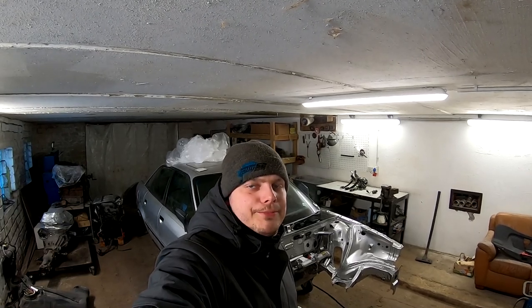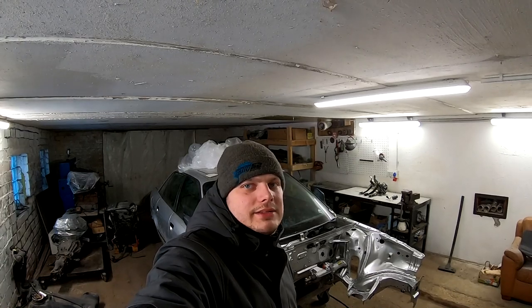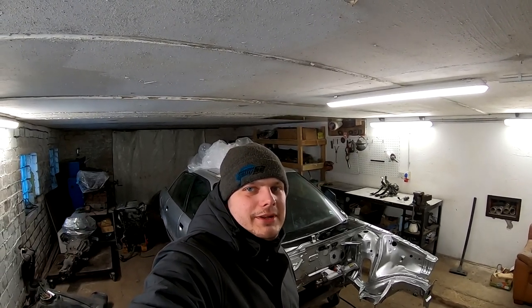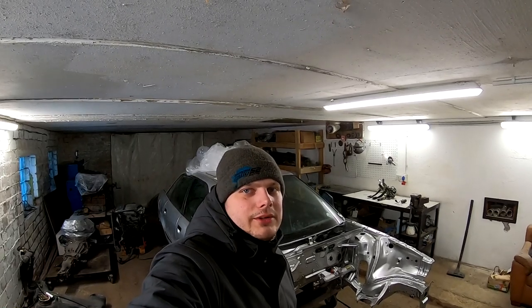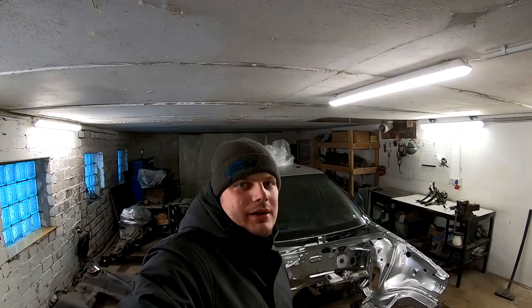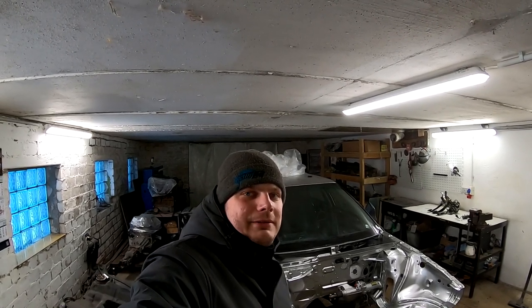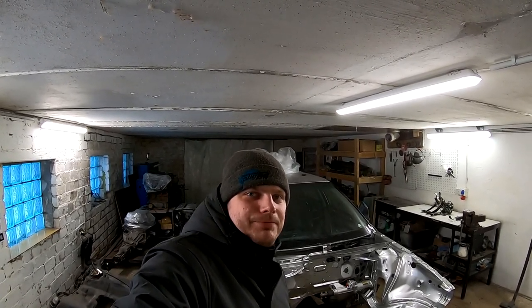It's from a B4 1.9 diesel, 1C I think was the engine code. But it's really hard to get one because they are really rare. I made a long shot, posting a topic in one local B4 group that I want to buy diesel pedals, and after 20 minutes one guy offered me one for 30 euros with shipping. I bought it and it was here next day. So yeah, really lucky. We need to change its potentiometer. I will show you. Today we work with this drive-by-wire pedal.